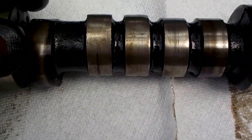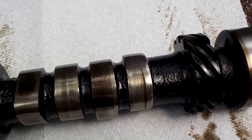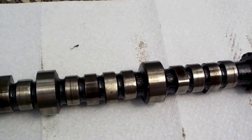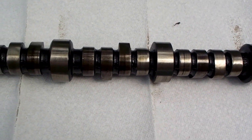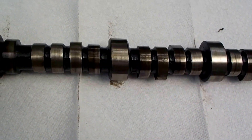Number 1 cylinder had just a little intake and a little exhaust, but if you go down here to 8, it looks like a bearing surface — it has no lobes whatsoever. So I guess I've got to figure out why this happened, but at least that's what the problem was.